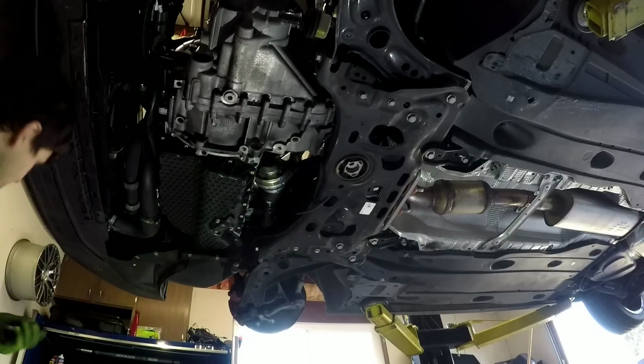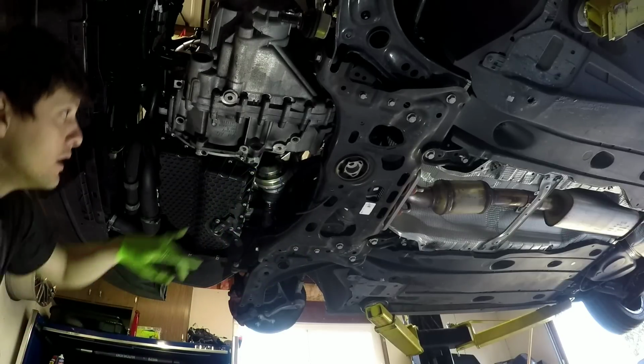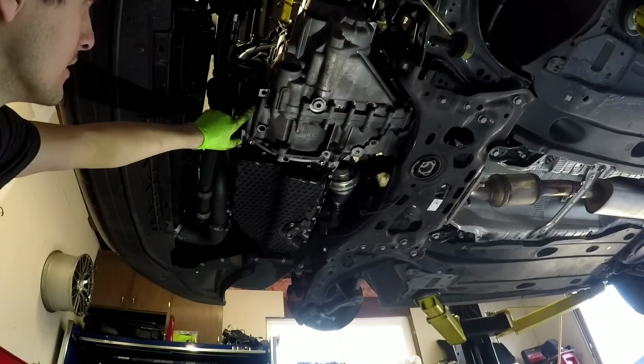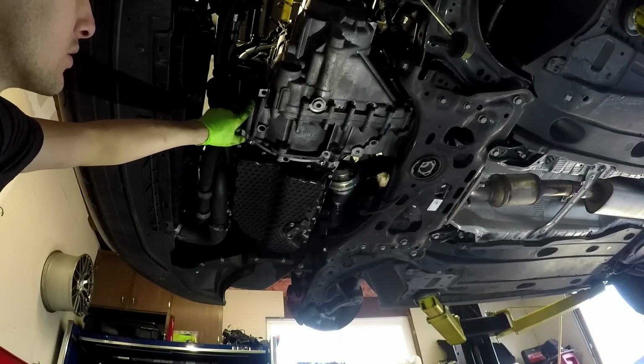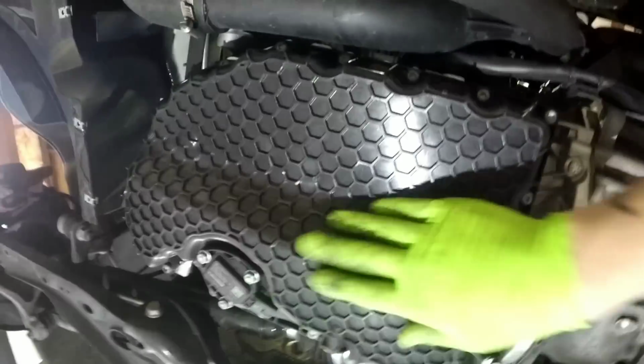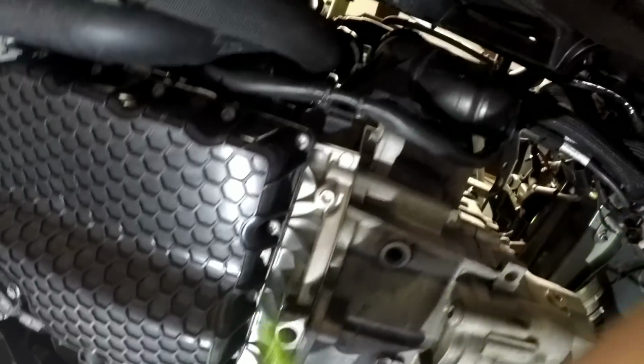Those go on the bottom. Okay, the only bolt holding this in now is the 16 here. So make sure your engine is supported. If you're doing it on the ground, you'd put something here to grab the metal, because you don't want to do it across your plastic pan and break it. This is just the tricky part, getting something in between here or here.